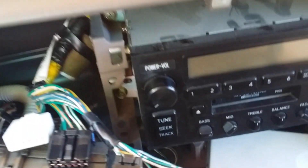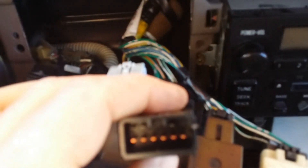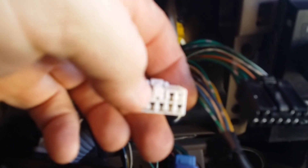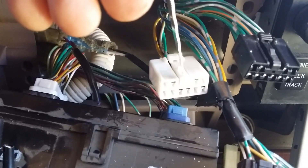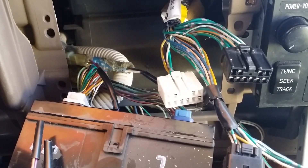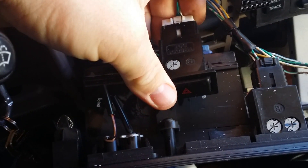All right. The camera's phone is not doing great today. We need to make a groove like that — this pin over the switch here has two grooves, so we're going to do that next. I just made a notch in there; instead of a knife I went with a little hacksaw blade and took that out. Moving on to the next step — doing a check on the switch and it clicks in.